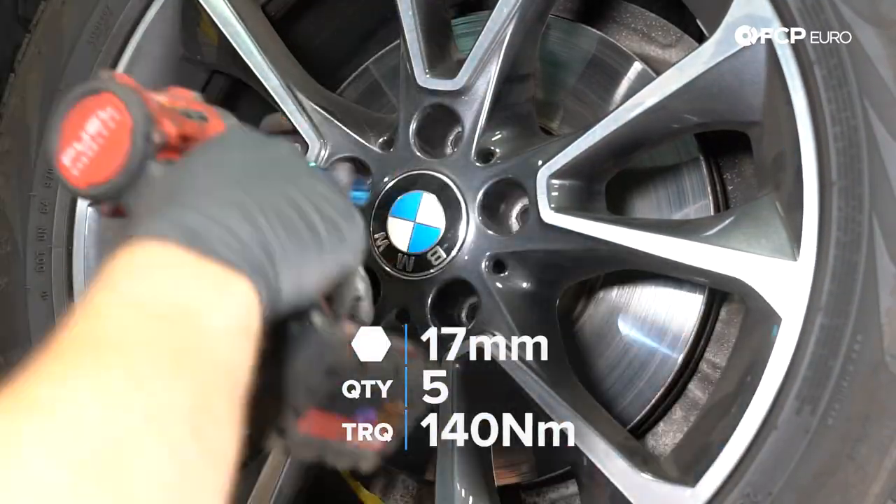Once the car is back down on the ground, torque the lug bolts to 140 newton meters in a crisscross pattern. Also make sure you pump the brakes a couple of times — you want the pads back in contact with the rotor surface because you had the brakes off the car. That first brake pedal push might not feel good, and if you're on the road you might scare yourself. Whenever you have the brakes off, no matter what, make sure you have a good pedal feel before you drive off. Every method we showed in this video — removing the axle with a hammer and brass drift, getting the wheel bearing off despite the aluminum knuckle and steel hub corrosion using brass drift and original bolts — is something you can do at home by yourself. We hope you learned a lot. If you have questions or comments, leave them below, hit like and subscribe, and I'll see you for the next one.